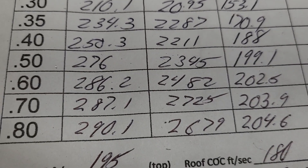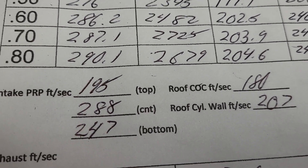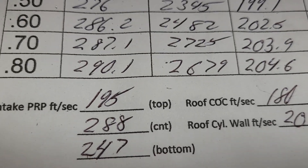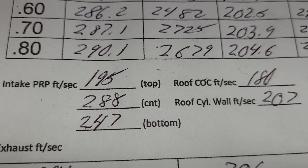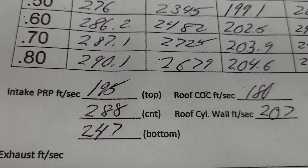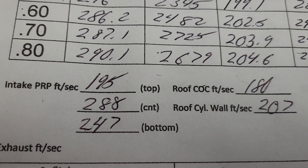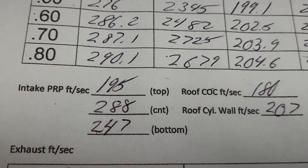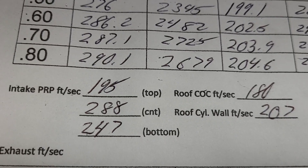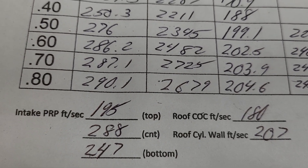Okay, that's pretty close. Now we're going to do the flow ball — I'm going to do it in three different places and we're going to see how much the flow goes down or up, actually. Put it on the short side — flow could go up. If I didn't do a good enough job on the short side, flow will go up with the flow ball on there. We'll check it right at the pinch, and then we'll check the middle of the short side and then the apex.